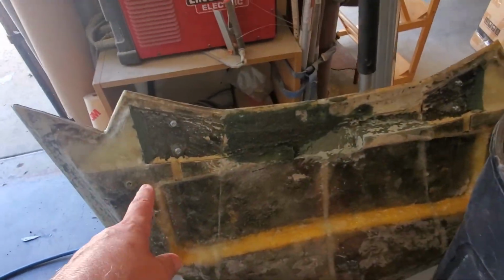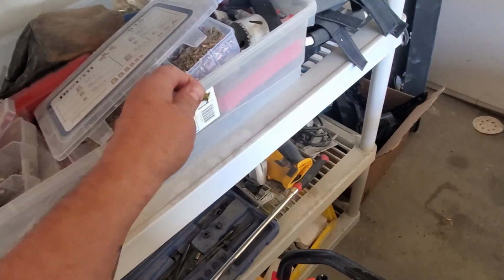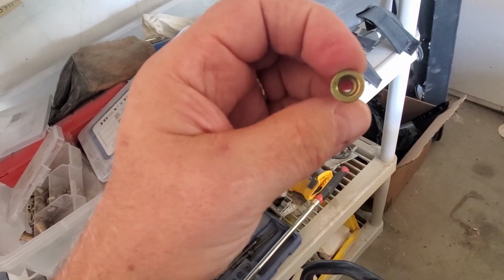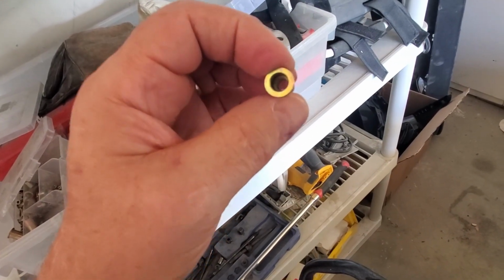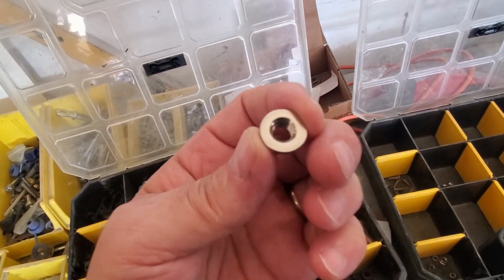The other thing I'm doing is I'm starting on the other side of the hood. I changed from these normal inserts for mounting the hood because they don't have enough thread, and they have a deep pocket so that you can get the screw in there. I have a relatively thin material, so I really don't have room for these. So what I did was I went to basically captive nuts. These are M8s, and I'm using these captive flange nuts.